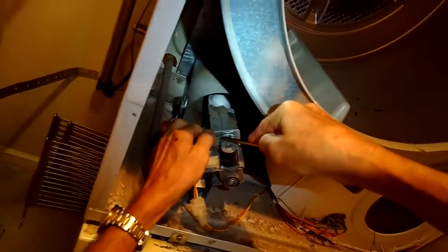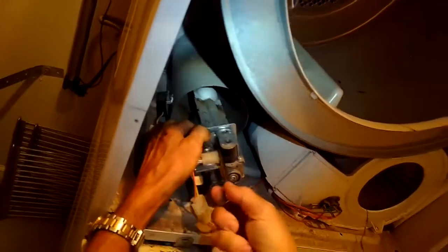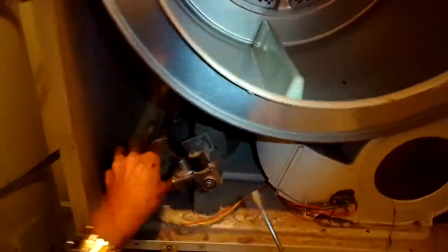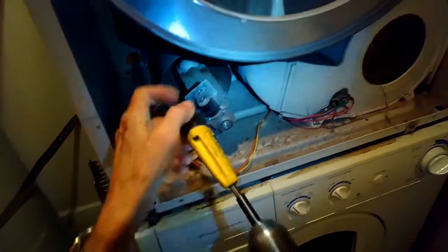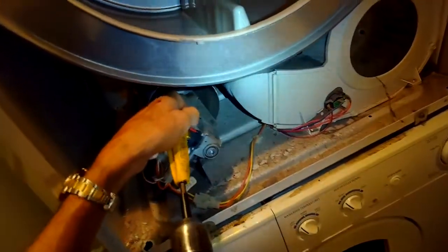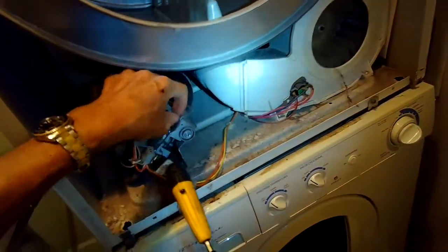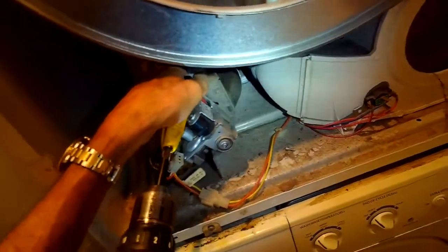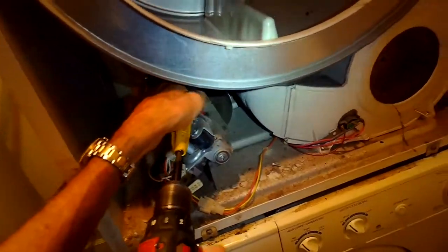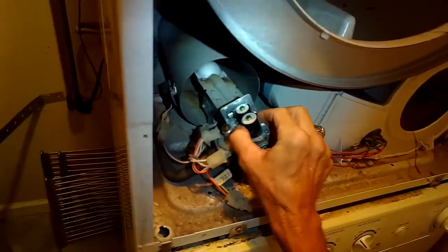They're just electromagnets. Pry off the second one. There are just two Phillips-head screws holding the coils into position. I use this interesting tool that changes the angle of the Phillips-head screw so I can get into this tighter spot — a small Phillips-head screwdriver would work too. I take out the two Phillips-head screws, lift up on the plate that holds the coils, and just pull them off the post.